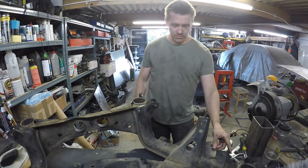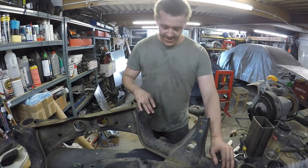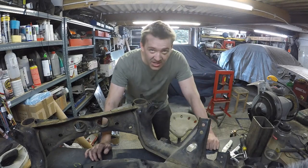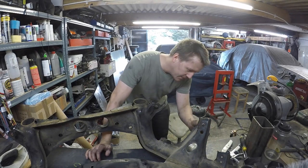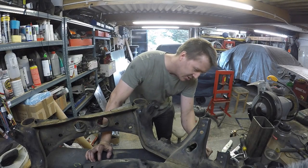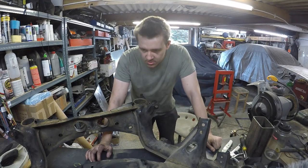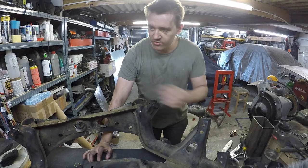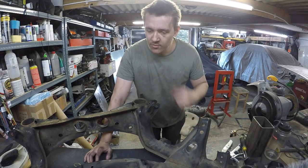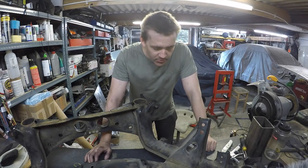Each lower suspension point, or each one on this main leg, had a little fillet underneath just to fill it in, so I'll do that at 2mm, that's easy, isn't it? And then under here as well, on the blue car, it had a kind of triangle insert in there with a couple of holes, and that's it. So we can do those four each side, make a few templates out, get them tacked on, and then what I'll do is I'll pull some of the arms over, stick them on, and just check that they all move and stuff.